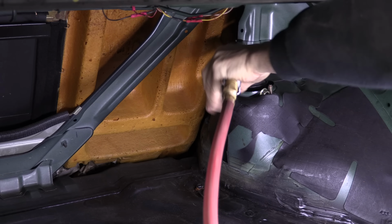I keep my promises. The Galant VR-4 has this weird all-wheel steering system that everyone disables, bolted right on top of the diff housing in the rear subframe. There's also a rack bolted to the trailing arms. These mechanisms read driver input for the front wheels and toggle the rear wheels in the same direction to keep the car flat at speed.